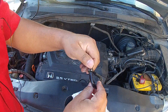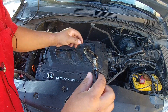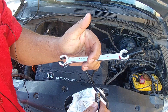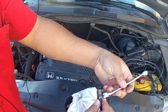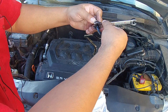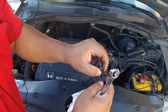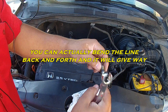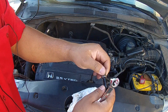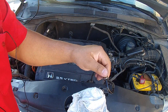Starting at the bottom — the 14mm fitting that goes into the power steering rack. You'll use a flare nut wrench; I picked these up from AutoZone, it came in a set for $3.20. Slide it over your pipe and it allows you to break that fitting loose. If you don't have this tool, you can cut the metal line and use a 3/8" 14mm socket over the fitting to break it loose that way. Sometimes these are really stuck, so you might find some difficulty with this fitting going into the power steering rack.